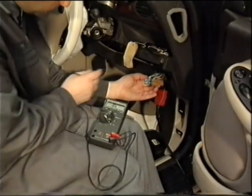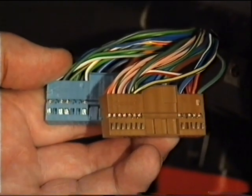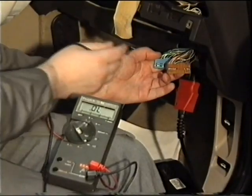If, however, a CAN bus-related instrument pack feature isn't functioning correctly, then the problem may well lie in the CAN wiring. In this instance, and under guidance from TestBook, a multimeter can be used to check the continuity and polarity of the CAN wires.